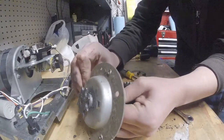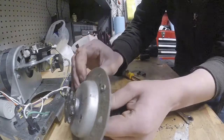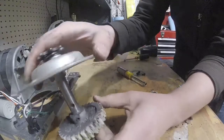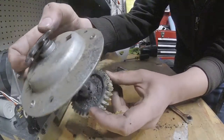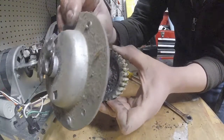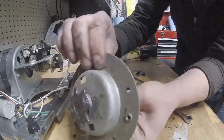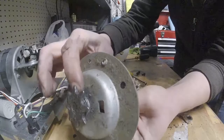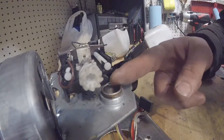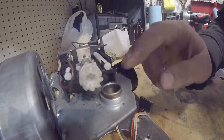There's not much left of that bearing. All the grease is full of crud from that bearing — it's probably just a brass sleeve. I spent some time cleaning up the inner surface of this bearing, or bushing as some might call it. I don't see any visible damage so I think that is still usable.